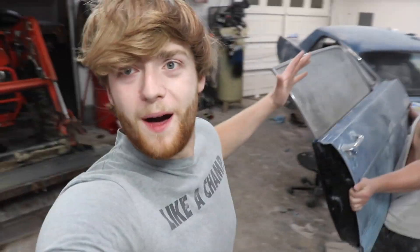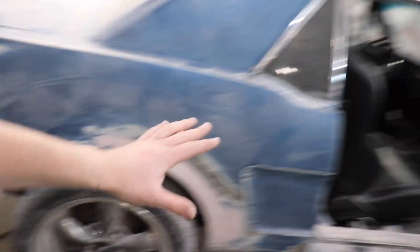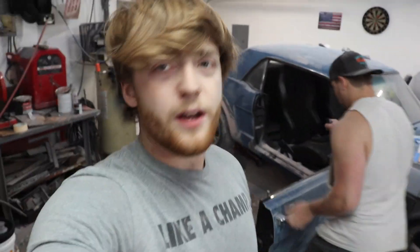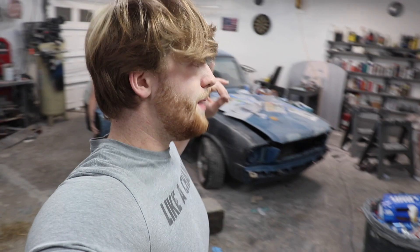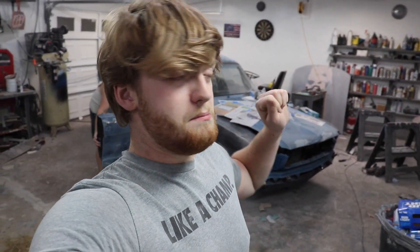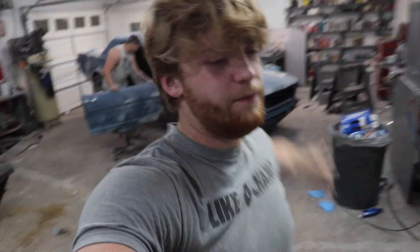It is the next day and this has been a long day — you guys have literally no idea. Charlie's got the door over here, we're finishing up the body work. Everything's getting wrapped up body work wise. I've been working hard on this rear quarter getting everything smoothed out, we're waiting on some stuff to dry. We got a little bit of sanding — got to run 120 and 220 over the whole body — then we'll get to washing and hopefully priming. It's about two in the morning. Let's get to putting a door on a car again for the 15th time.